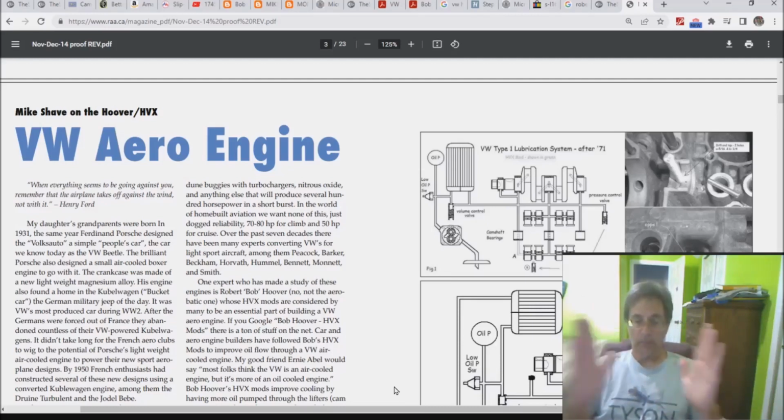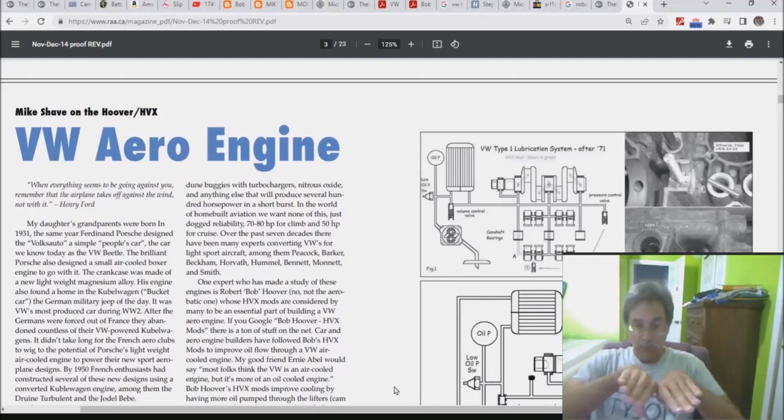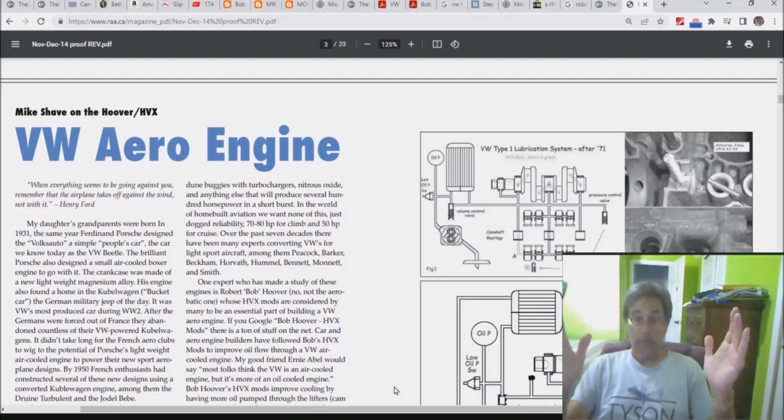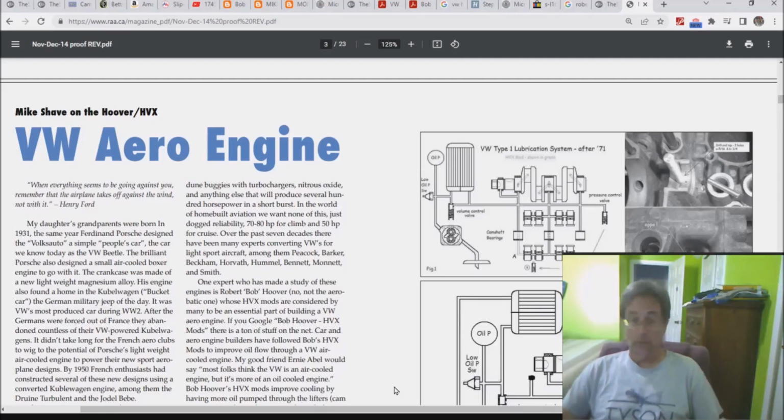So it goes small volume, now the pressure inside the case is high, it's got to bleed off, so it goes out the push rods. Then it goes up like this, increasing the volume, and you suck the air back in the other direction through the push rod tube. This is going to create windage.